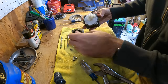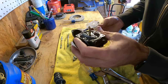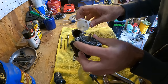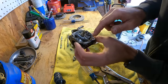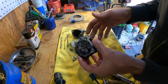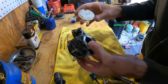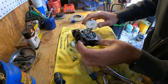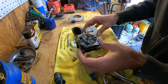We'll take our needle and seat out. There's crud everywhere. This O-ring right here is what seals — a lot of times those get warped or old and cracked and then they just leak by. There's just this gummy stuff all over it. I'll probably throw this in the ultrasonic cleaner and then lightly blow it off with compressed air and take it from there. It looks like our main jet was not blocked, but our low-speed jets were, and there's just crud everywhere. Let me get everything thrown in the ultrasonic cleaner and hopefully we can get this going.